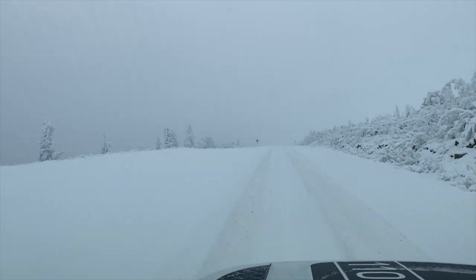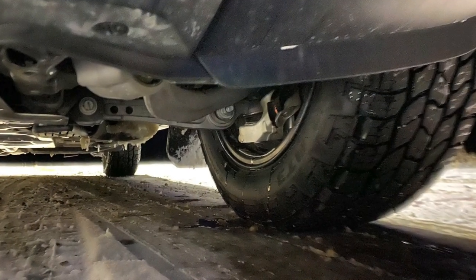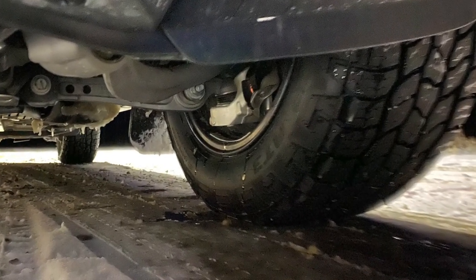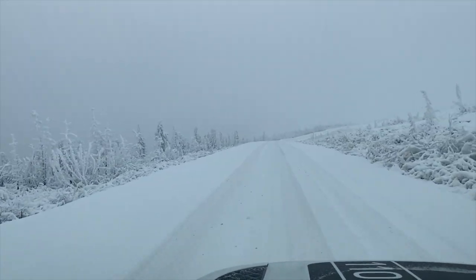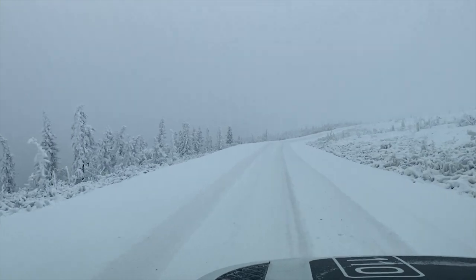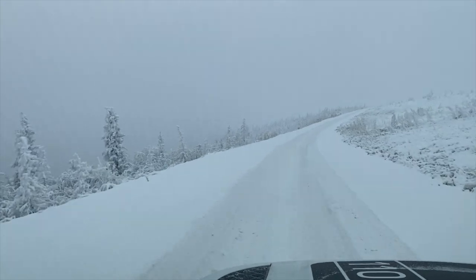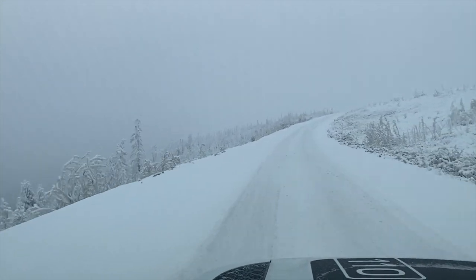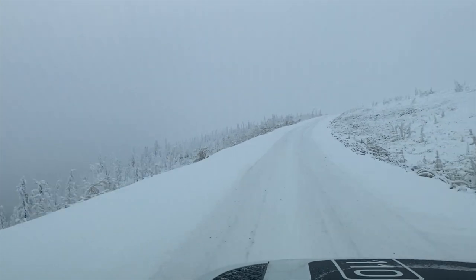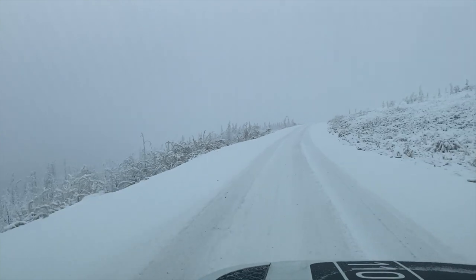The tyres don't slip so much because of course they've got a pretty good bite — but also because of the ABS. I'm going to go down to this bit here. I'm doing 60km an hour now, I'm on a gentle downgrade, and I'm going to start braking when I just get onto this flat here. OK — I am now applying brake fairly hard. That's hard down.